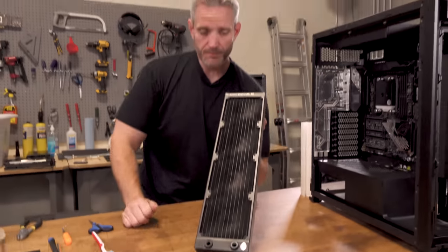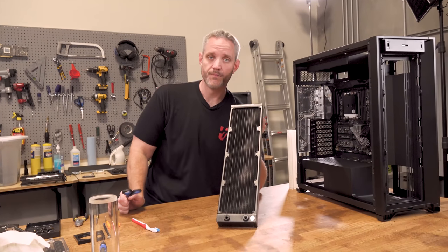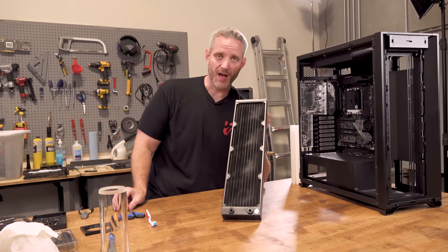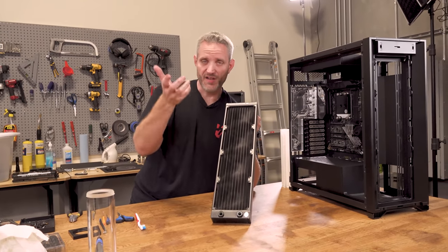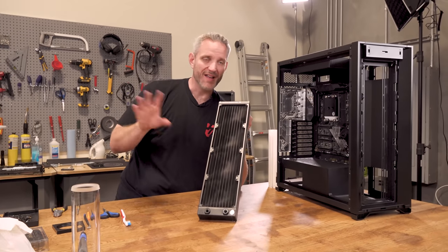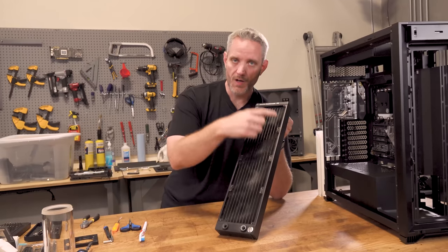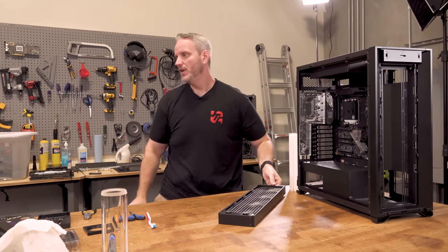So what I would do is run the hottest water that I can. Even radiators that have no fans have passive cooling to them, so I would dump the water out and repeat with hot water as much as possible. You can also just use sink water on the tap as high as possible — your faucet is threaded, so you can actually get G-thread fittings that thread onto a G quarter, put a barb and a tube, and just let it run. I would take the original outlet and turn that into the inlet to get reverse flow, so we get water going into areas that would typically bypass because of the turbulent corners.